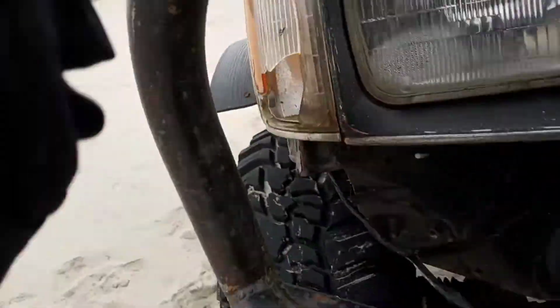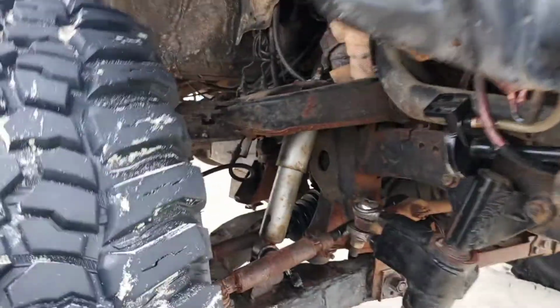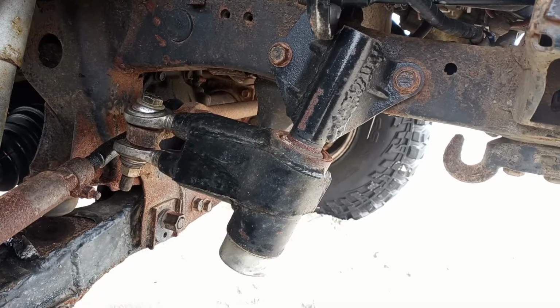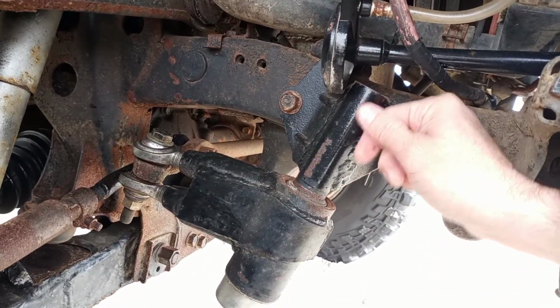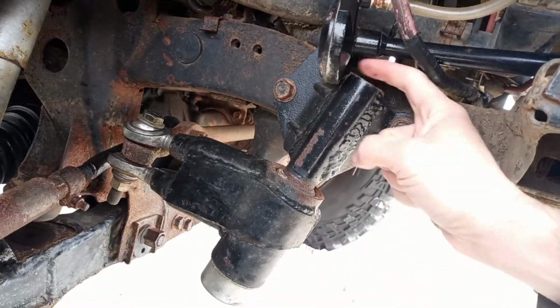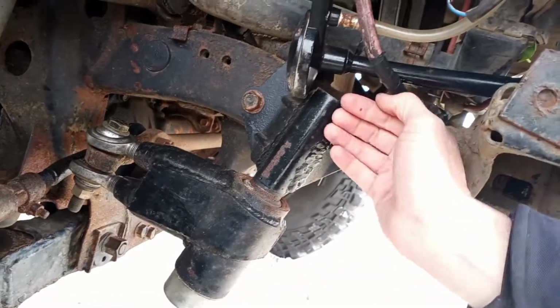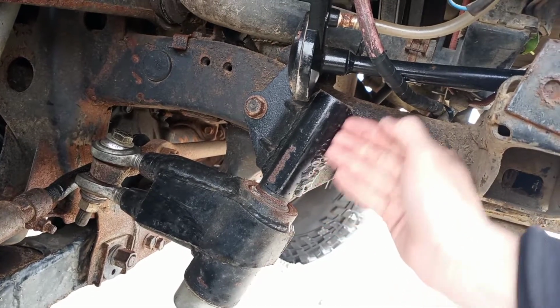The only thing I noticed big time was my idler arm. I snapped 3 idler arms when wheeling. I needed something beefier, so I built this. This is a 1-inch trailer spindle, factory idler arm bracket that I cut and ground down to fit this perfectly. I did a root pass, 2 base passes, and then covered it up again, so it's got a total of 4 beads of heavy weld going through there.